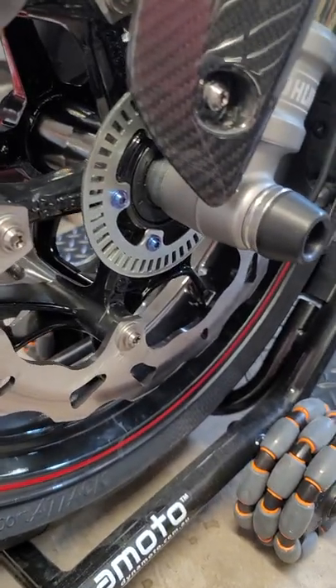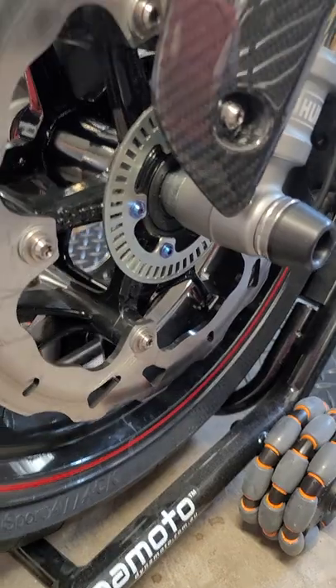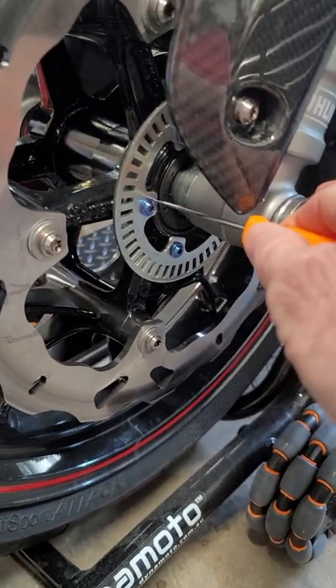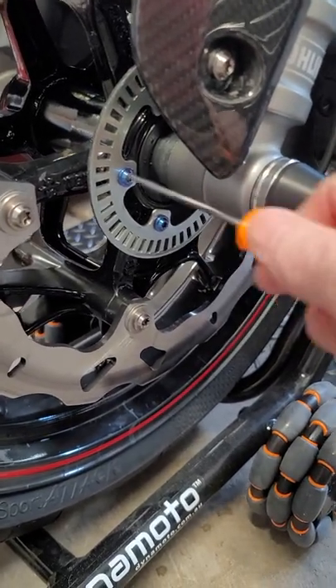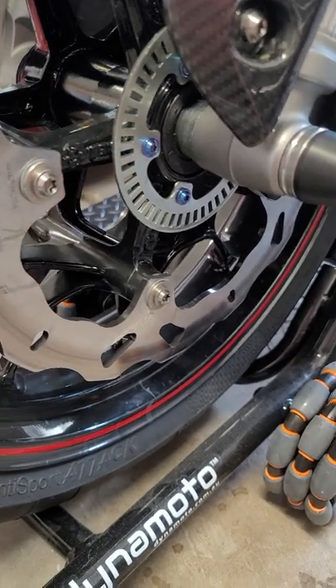This way works fine. I've seen a couple other guys here in Vegas that have now done this, with the same result — no problems at all. It's important that this is done to absolute precision because the tone ring cannot spin out of round. It can't be egged or off by even the slightest, otherwise the magnetic sensor will get an incorrect signal.